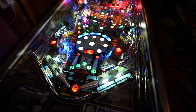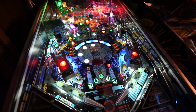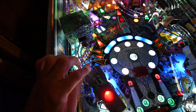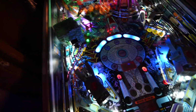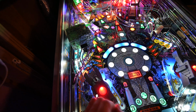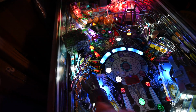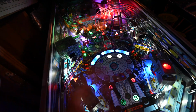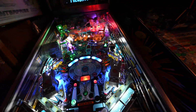These games were known for, I guess, two negative things. One was maintenance. They have 18, 20-something optos. So you've got the little optical sensors, like the old barbershop entry door. There's some of these in the cannons. If the little plunger that shoots the ball out gets stuck, then it'll continue to break the beam, and the game thinks there's a ball there, and it continues to sweep back and forth. So cannon maintenance is important. Opto maintenance in general is important.